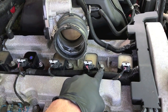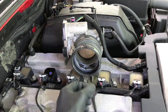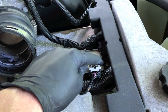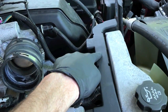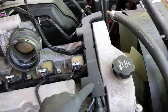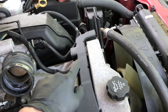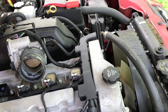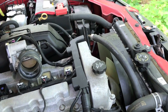I say that because look at this little bolt — it's a 10 millimeter bolt. You have them on all the ignition coils, and by loosening up that bolt you can actually pull the ignition coil off the spark plug. However, ignition coil number one is a little tricky to access that bolt. What I do not recommend is trying to pry this plastic case off that houses electrical wiring that feeds over the engine, because you are going to snap all the prongs while taking it off. At that point you have to replace that entire plastic case, and if you don't, when you put everything back together that plastic case is going to be loose on top of the engine — and that's not good.